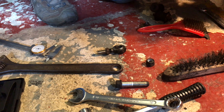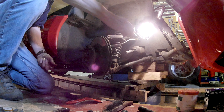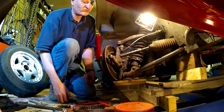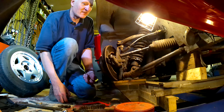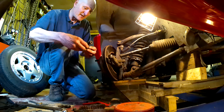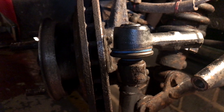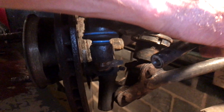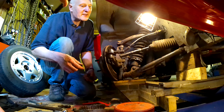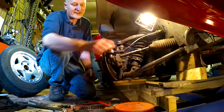It would probably be a good little project to retrofit it. It wouldn't be that hard to make them fit. And then it's just a case of buying a couple of arms, which shouldn't be too much money — maybe a £20 pair second hand. And that would definitely fit in there. It's still clear vented disc. Tons of room. Didn't make any sense when they used a rose joint. That's not a left hand thread, is it? Looks like a normal thread. I can understand if they just put a right hand thread at this end and a left hand thread at that end, and then lock nuts up.